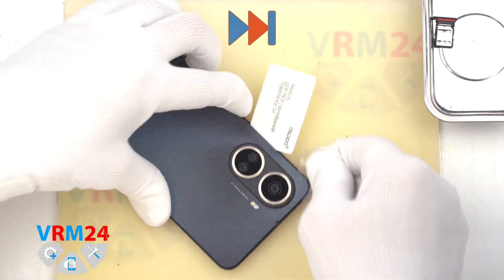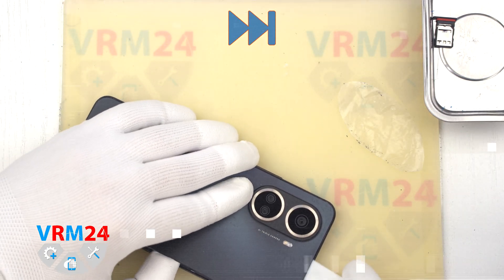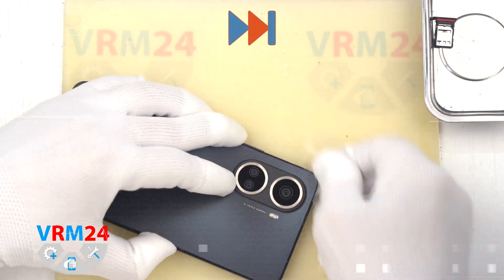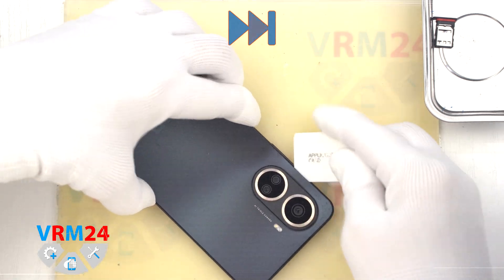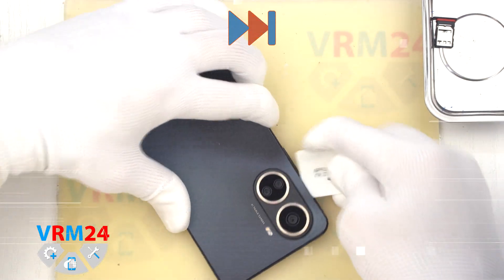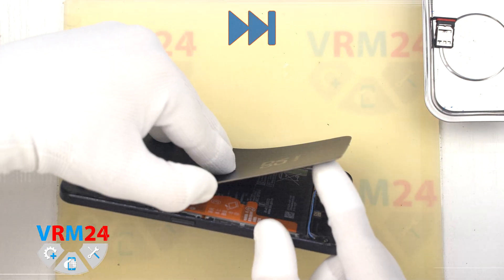The section that protects the back cover cameras itself is more rigid. It is made with specific glass and has a small plastic area for which we can carefully use a thin tool to pry and leave this part to un-glue. It is not necessary to use force — we have to be as careful as possible so that we don't accidentally damage anything.